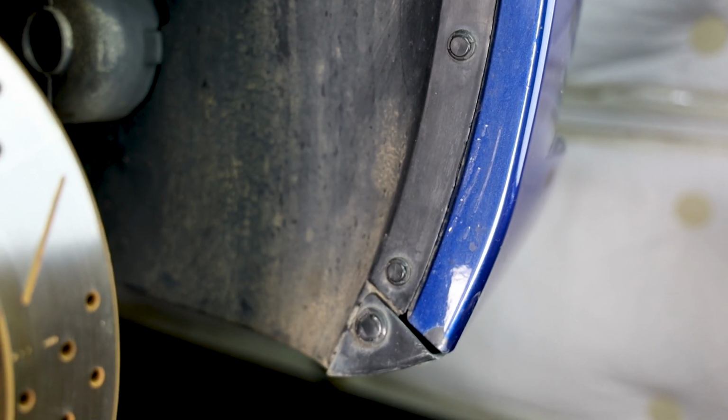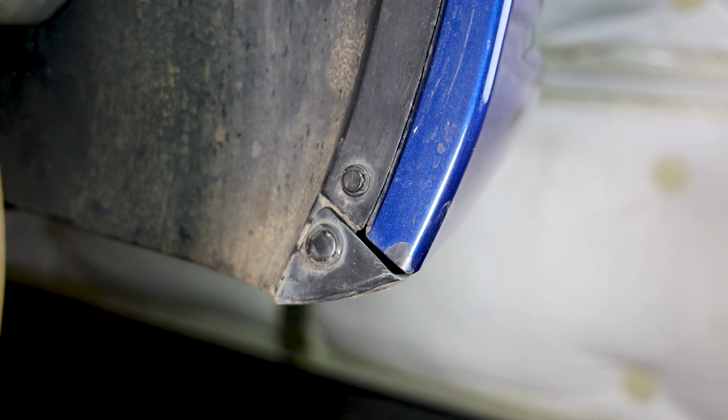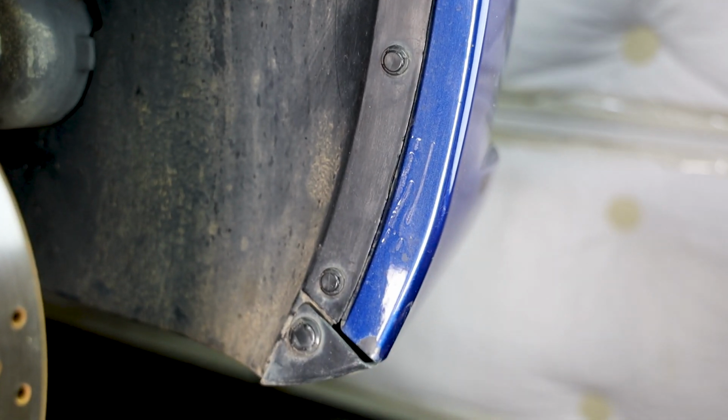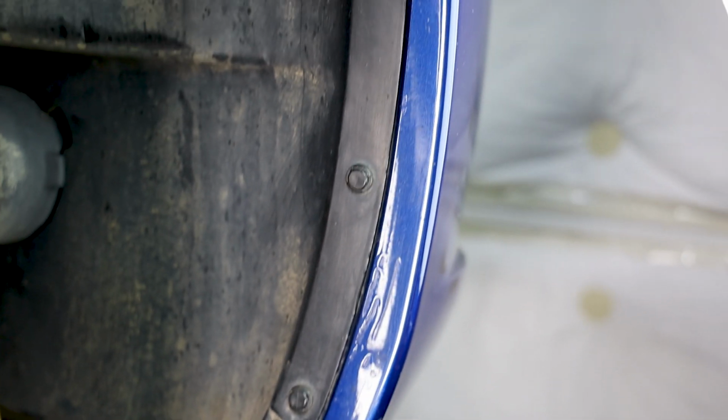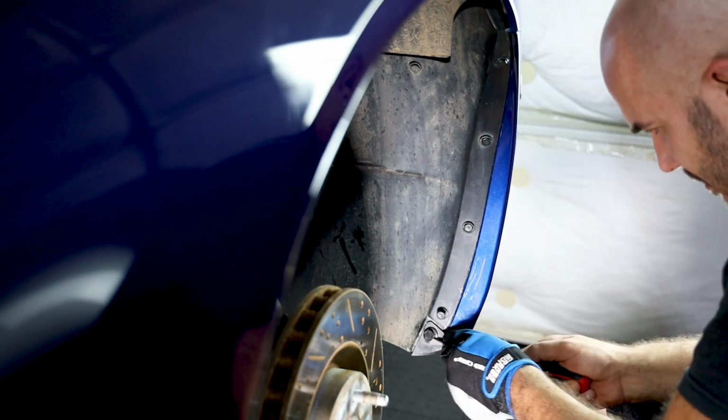Alright, so going inside the wheel well area over here, I'm on the passenger side. Depending on the year, you're either going to have a plastic clip at the bottom, followed by 4 bolts, 9/32 up here, or you're just going to have, like I do, 4 more plastic clips that can just be popped out to gain access to the inner portion of the bumper liner.